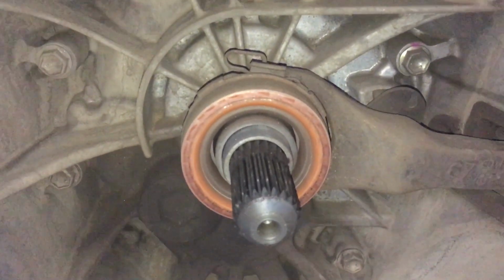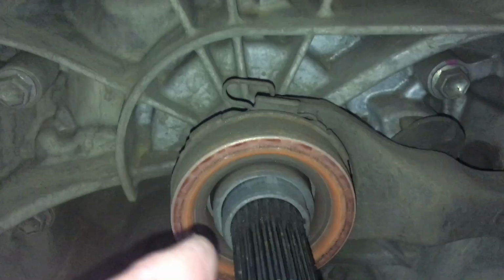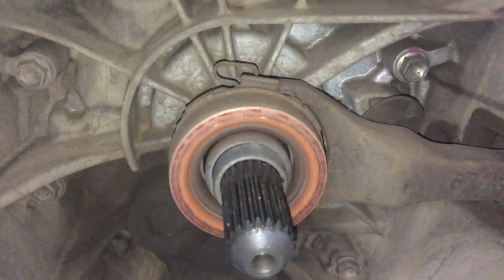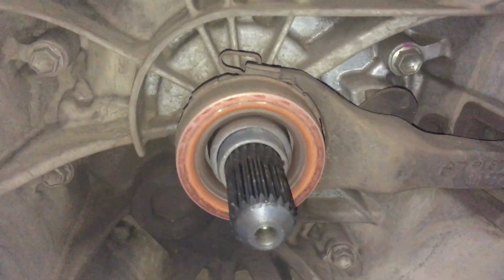and also it's actually quite timely we're doing this video because the bell housing here, it's all alloy. See this case, it's all alloy, right? And it's all one piece all the way through here, all the way up here to what I call the snout. Now on the older gearboxes, or the 5-speed, there was a cast iron section that went on the front that you'd unbolt the front cover and you could take it off. Because it was cast iron, it didn't wear, and because you could unbolt it, you could replace it if necessary.